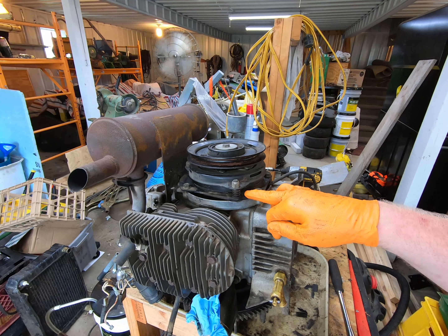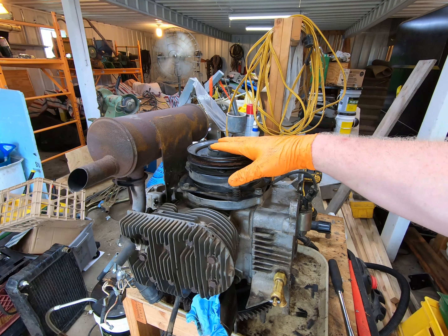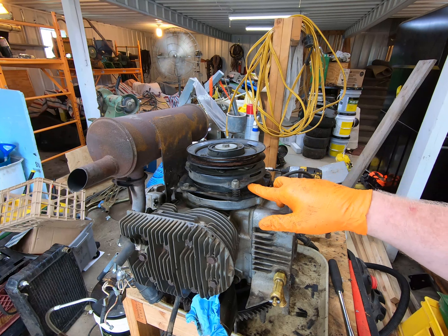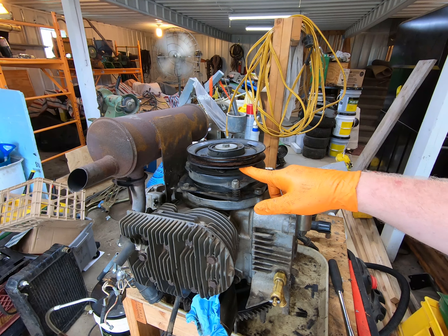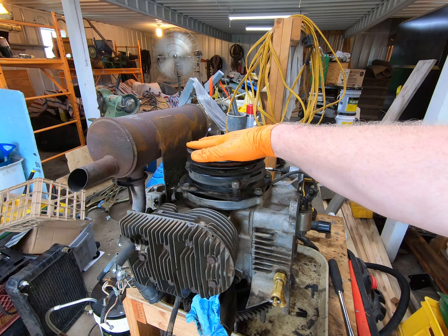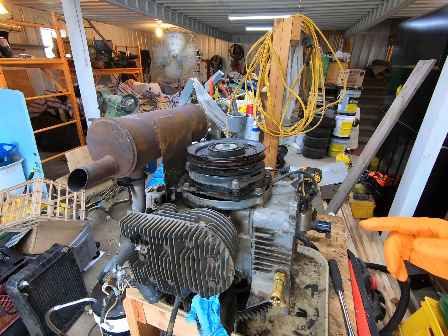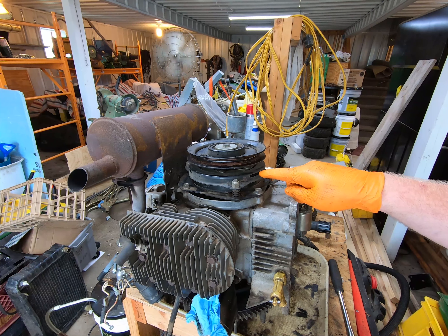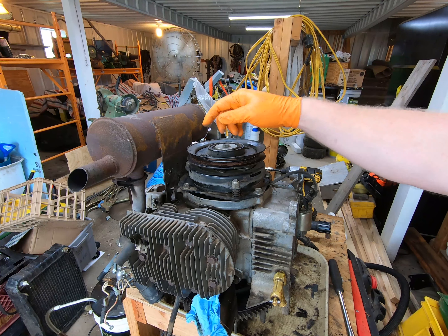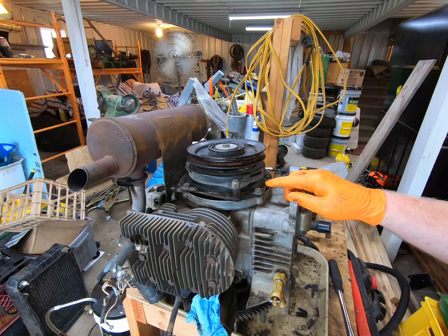To explain how these work: you have your electromagnetic coil attached to the engine, your clutch disc, and your rotor. When the coil is magnetized, the rotor attaches to the clutch disc through the springs in there, pulling it in — that's what engages it. There are three little access areas around the clutch with three adjustment bolts, and that's how you adjust the air gap. The air gap is the gap between the rotor and the disc itself.